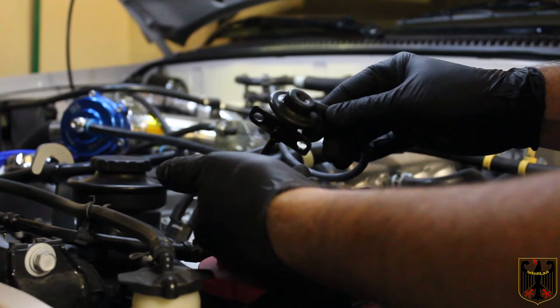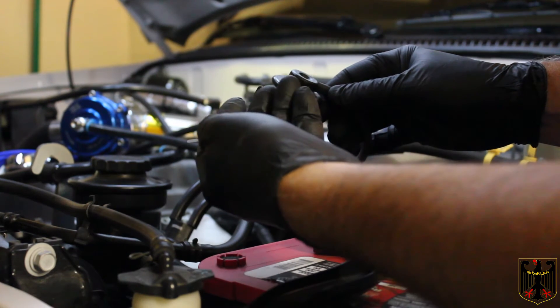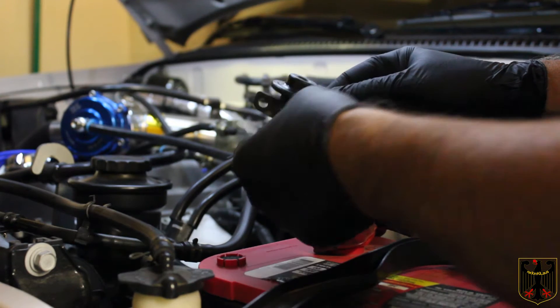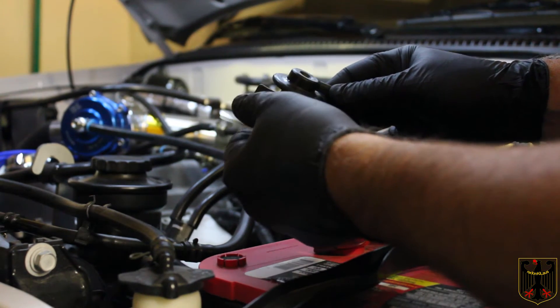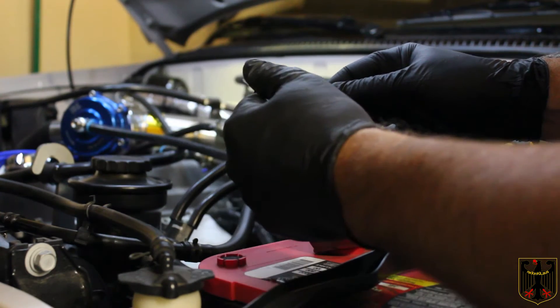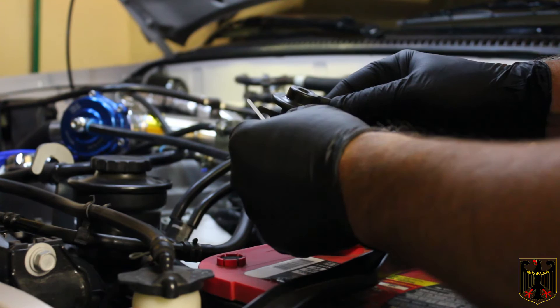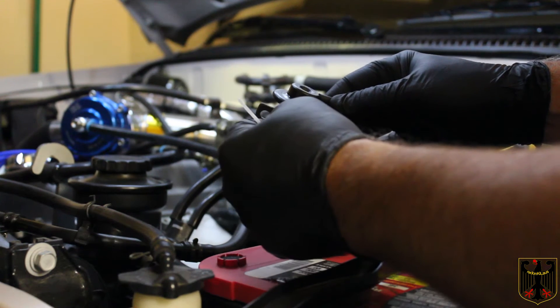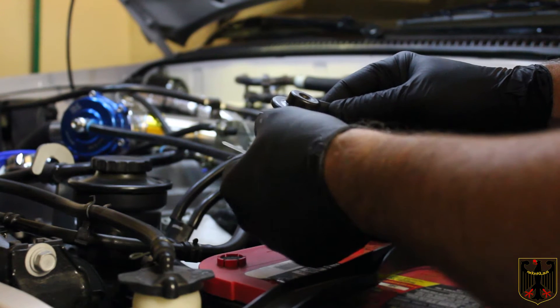At this point we have the pressure regulator loose and I've pulled the o-ring off. I used a wire tie to slip it under the o-ring to pull it loose, because we're going to put a new o-ring on. The kit comes with two new o-rings — one for this and one for the other piece that goes into the engine block. We're going to put some Krytox on those o-rings, assemble them, and then I'll come right back.